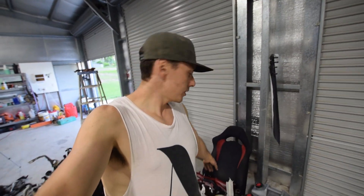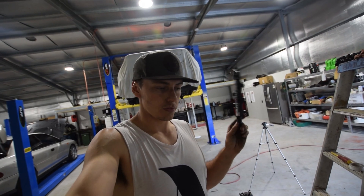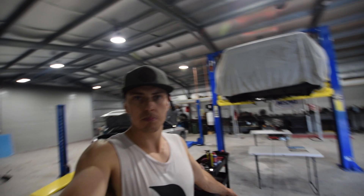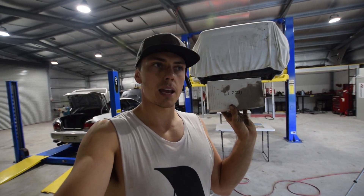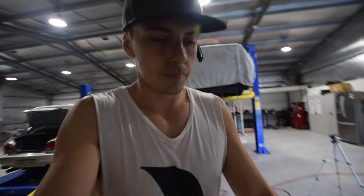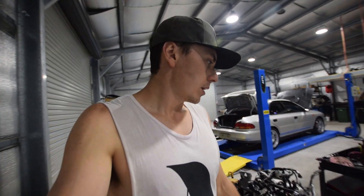Everything else is pulled apart — manifold down here, inlet manifold on the ground, all the other stuff on the ground too. I've got my radium fuel rails which are covered in oil from when I turned the engine upside down and didn't even realise. The inlet tube is going to go up for sale soon. I got 1300cc Bosch injectors when I bought the motor, but I've since got these ID2000s fully tested and cleaned by a company down in Melbourne. They're within 0.1% of each other — 1300s probably would have done it, but it's nice to have the wiggle room of 2000s.